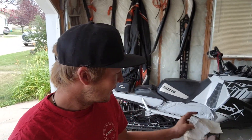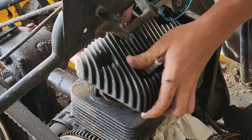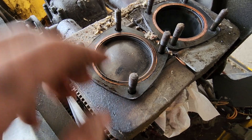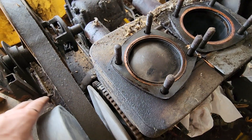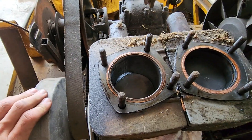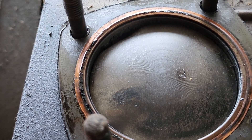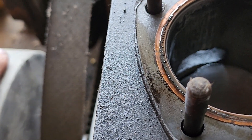Now that we've got all that stripped off, how would you guys like to look inside a motor? This is what your snowmobile engine looks like when you take the cylinder head off. A modern sled engine would be a little different — it would have additional cooling ports for water cooling — but this one is a little old for that. If you look in here you can see the bad news, which is scoring on that cylinder wall.